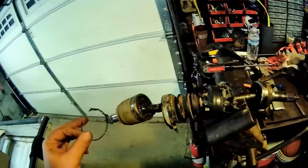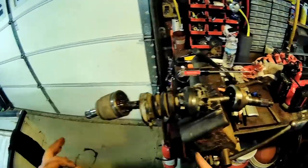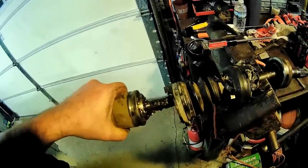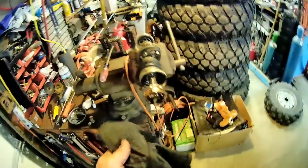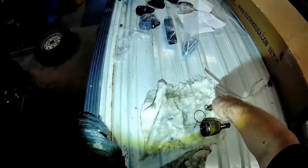This stuff is a highly machined precision part, so you definitely don't want any dirt. I'm definitely gonna clean everything and put fresh grease, especially on the end where the boot was ripped. Now, slide that off. There should be a little circlip in this end — don't spread it any more than you have to, cause you don't want to stretch it.